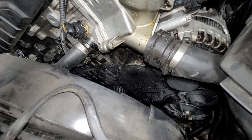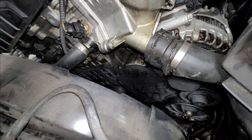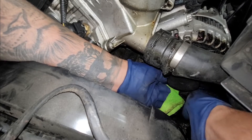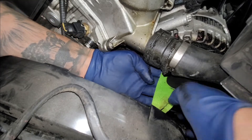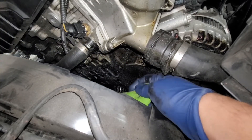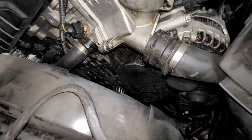At this point I would recommend you clean each pulley. If you do have oil, there's a reason why your belt fell off. So I'm spraying some brake cleaner on a rag right now. I sprayed it on the rag and I'm going to go right here at the idler pulley and just clean that up. Same thing — we're trying to clean these pulleys as best as possible. You can see that's all the oil coming off. I'm going to pressure wash all of this — we've got a lot of oil on this crankshaft.